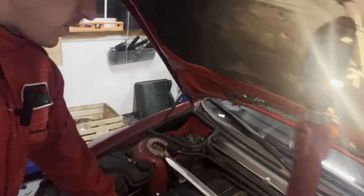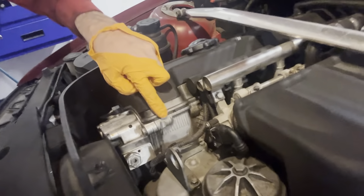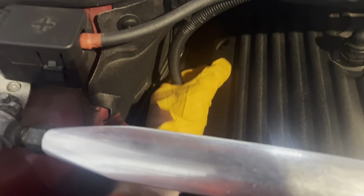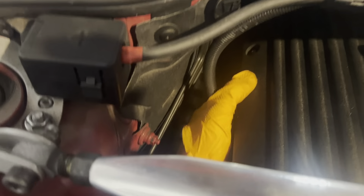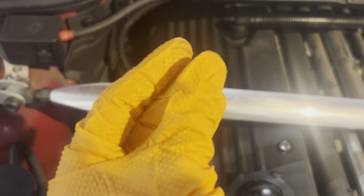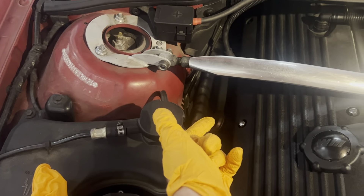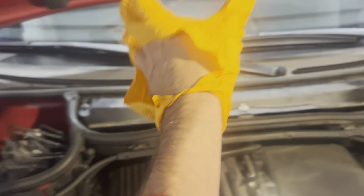This is the thing that is leaking. It seems pretty chill up front, but the leak is actually in the back — if I touch it with my finger you'll see oil residue. The way I figured this out is while driving, when the car gets hot, oil spills on the exhaust and burns, and the cabin smells like burnt oil. That's the diagnostics — it's a very common issue on these engines.